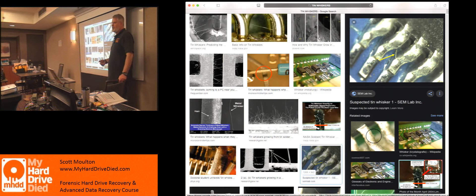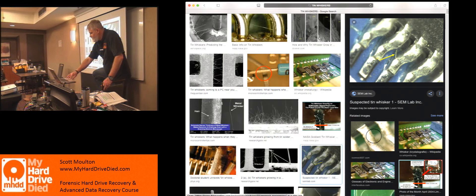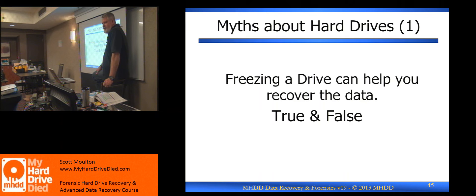That's one of the first processes we do when drives come in not working — we just go ahead and start cleaning them. We have transceivers and things you can put in a bath and wash; Scrubbing Bubbles is common for phones. Surprisingly, sometimes freezing it breaks a whisker free because now you've got contraction, then it gets warm and expands, and it breaks the whisker so it'll actually work.